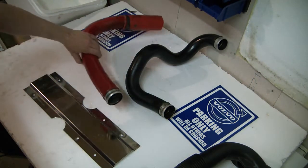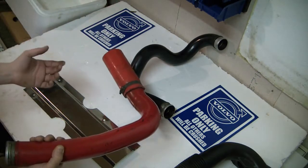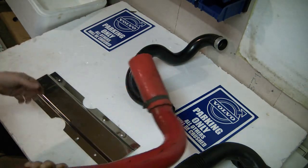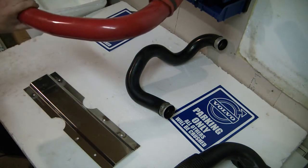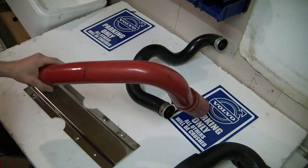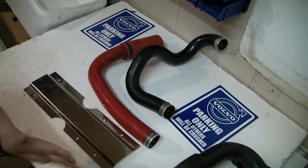The biggest benefit of reverse intercooler piping is faster turbo spool-up, because air moves more freely. You won't gain more peak horsepower, but in the low-to-mid range you may notice the turbo pulls up more quickly — though nobody has dynoed a direct before-and-after comparison with just the piping changed. Another reason to fit it is aesthetics: it makes more of a visual impact when you open the engine bay, and could even fool someone into thinking a naturally aspirated car has a turbo.